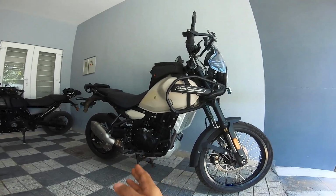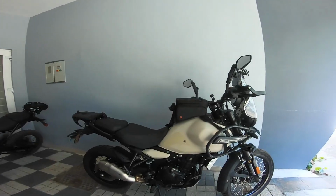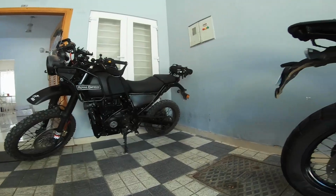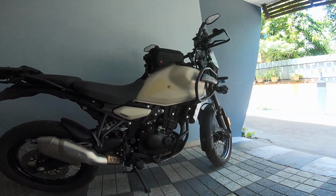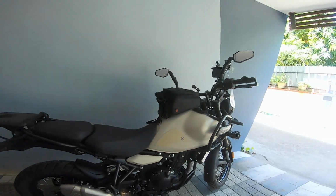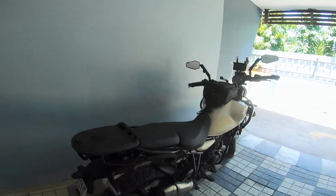Engine oil stands at 10W40, semi-synthetic from the manufacturer, but of course you can swap to a fully synthetic. If Ben can run on fully synthetic, this can easily run on fully synthetic. An over square engine, so fully synthetic oil will definitely help. So that's a 10W40 fully synthetic for this. What else? Yeah, that should be it.